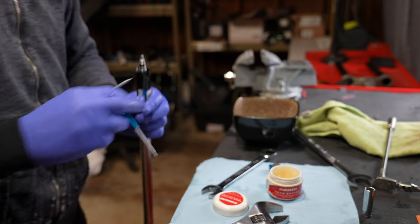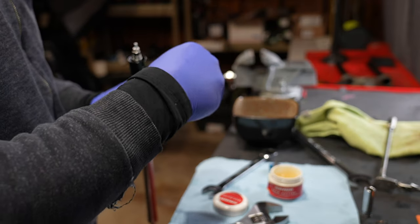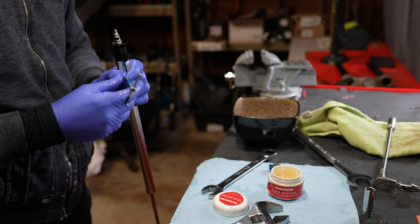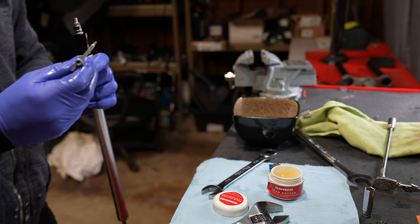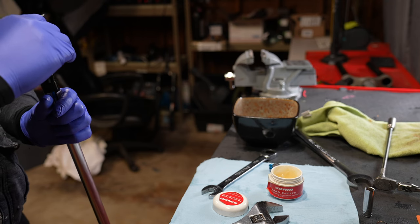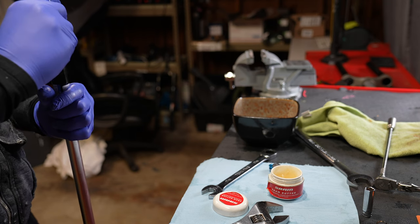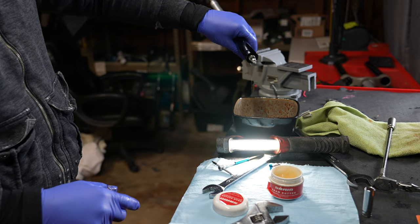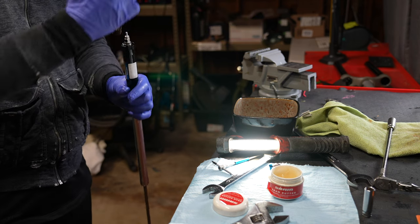This is the most challenging part of the entire job. Take your tool, put it in grease, get the bleed screw that screws into the IFP, and go in upside down — the grease will hold it in place. You really need a super long two millimeter allen key. It was probably one of the hardest things I ever did walking the thing in sideways with T-handles. Once the bleed screw is in there should be a little oil since that bleed hole needs to be overfilling — drain this out, put the spring in, and the top cap will screw right in.